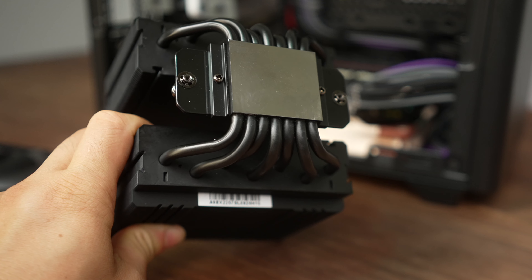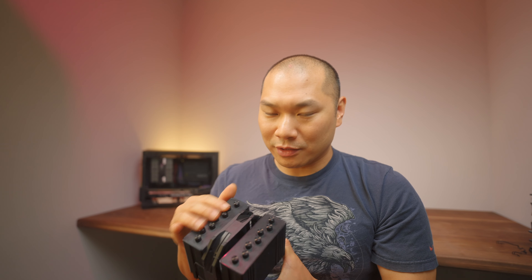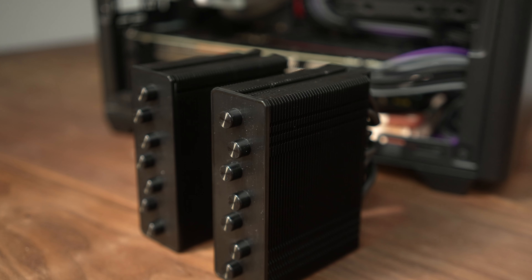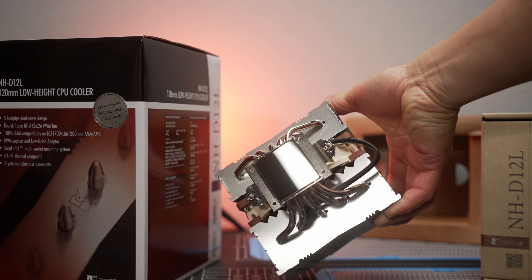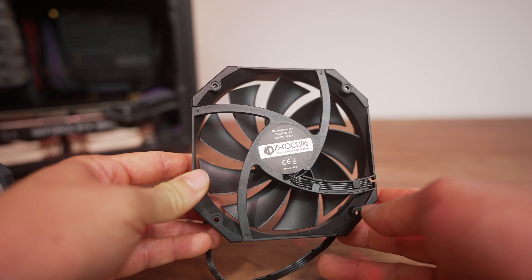You get a matte black heat sink with quite a few heat pipes — the headline feature here is seven dual-loop heat pipes running through the nickel-plated base plate, with a basic plastic heat pipe cover at the top. ID Cooling often puts their branding on these covers but not with this one. The two split towers are rectangular with no meaningful sculpting, unlike the Noctua or Thermalright which has airflow grooves. The heat sink mass is 630 grams versus 615 on the Thermalright SS-135, and there's no RAM overlap with either on an ITX board. Both coolers come with a basic 120 millimeter fan, and it's a stealthy-looking cooler in black that performs quite well out of the box.